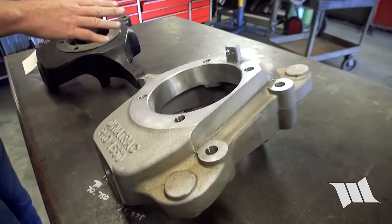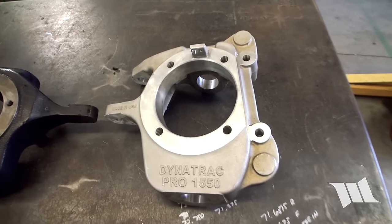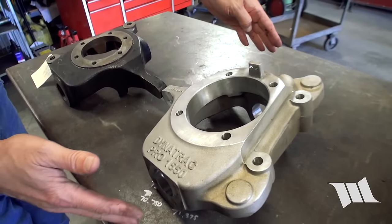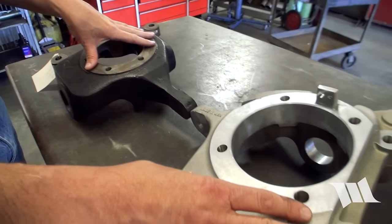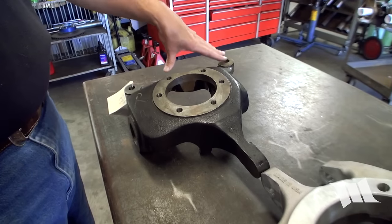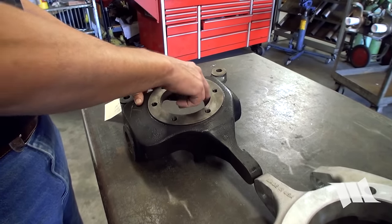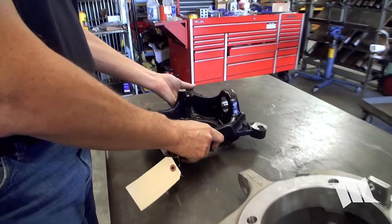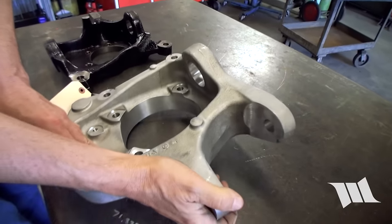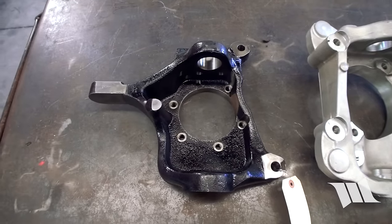To compare the new 1550 knuckle to our Pro 60 knuckle, which we've had for a really long time — you can see that the 1550 knuckle is taller, and that's because the bigger axle joints need more swing, so we had to move the ball joints out to give us that room. But that longer stance also gives a lot more support, so the ball joints have more leverage on the tire. This one is made out of nodular iron, this one is made out of military-grade aluminum. The spindle mounting bore is also a lot smaller on the Pro 60, because it was originally designed just to handle 1480 series Dana 60 U-joints, whereas the 1550 is designed to handle much larger joints. The ball joint insertion style is really the same — ball joints both press in — but the 1550 knuckle can take a bigger ball joint set than the old Pro 60 knuckle.